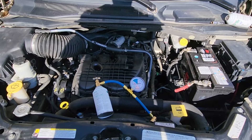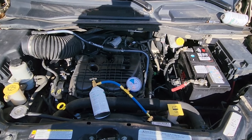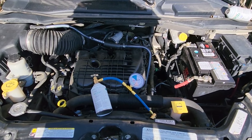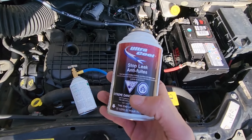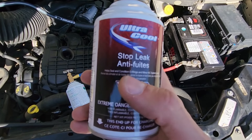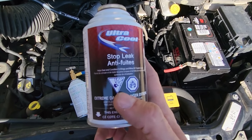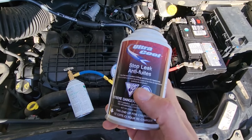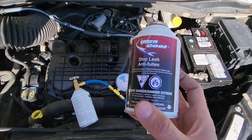All of this will work in case there are no major leaks in your AC system. If there is a leak or if your AC compressor is not working, you will have to take the vehicle to a mechanical shop where they can test for leaks, test the AC compressor, and fix it before recharging. If you have a minor leak, you can try using a product called stop leak — it helps seal and condition o-rings and minor AC system leaks. I've tried it a couple of times and it did help, but it only works for smaller leaks. It should get you through the summer, then recharge again next summer, but eventually those leaks will get bigger and you will have to fix them.